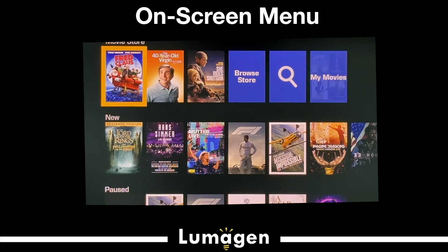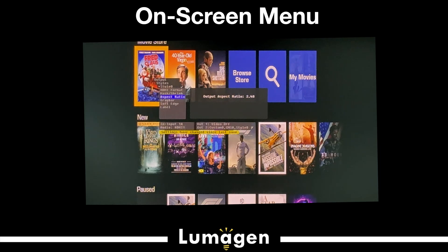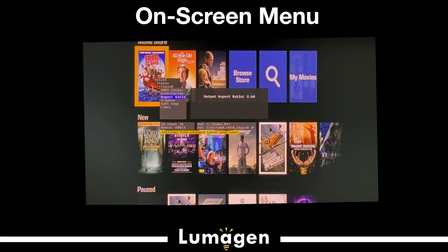After you do that, you set the output aspect ratio in the style menu. We have output aspect per input aspect, but you can also say 'I always want one aspect' — that's typically what you would do, single output aspect. You enter 2.40 and press OK. If you told it 2.40, we're going to size the 16x9 image correctly for your screen — so based on what content you're watching, whether it's a 2.40 movie or a 16x9 movie, it'll automatically put that image up on the screen.